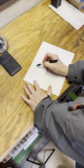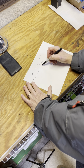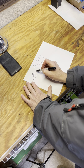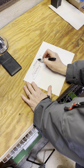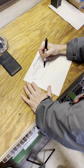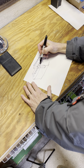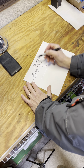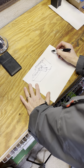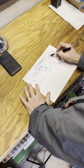What we've got here is a V8 engine — eight cylinders, all of the same size. So what you want to do is just figure out the volume of one of these cylinders. Each one has a bore and a stroke. I probably drew that a little bit out of scale, but we have to figure out the volume of the soup can, basically.